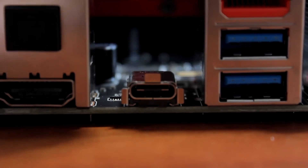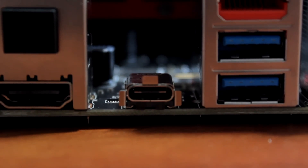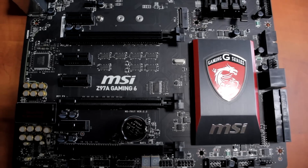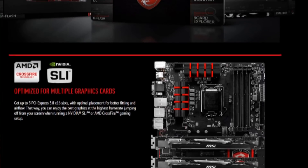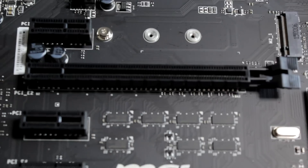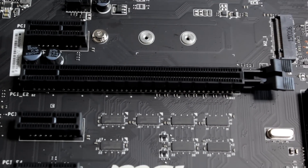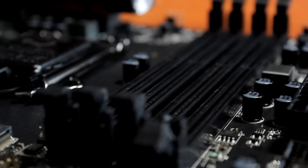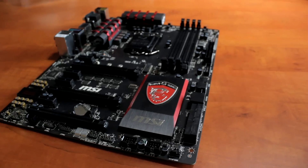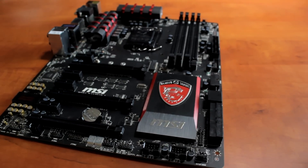This is the next top-notch level. At this point USB 3.1 can hit 10 gigabits of bandwidth, which is freaking fast. Let's talk about the graphic cards — it's got three physical x16 slots, so that means you can run up to three graphic cards. This motherboard also has four x1 PCIe slots. We have four DDR3 DIMMs with support for dual-channel memory with a max capacity of 32 gigabytes.